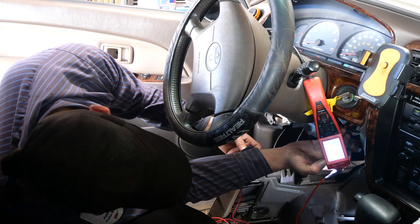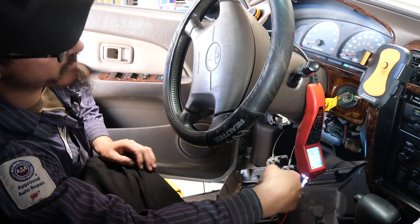As you saw, it switched to power and the relay turned off, so we're getting power through the relay — that's fine. For the next step, we're going to verify under the car. The location of the fuel pump connector differs from car to car. Some are under the seat, some you can remove the bed of a truck to gain access. In this case, I may have to get under the car to reach the fuel pump connector itself, or possibly drop the tank — there may be an intermediate connector.